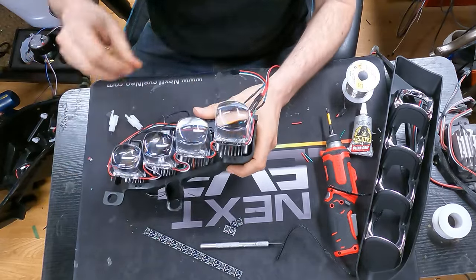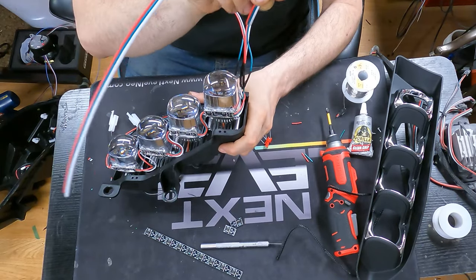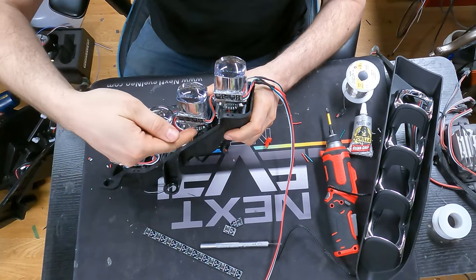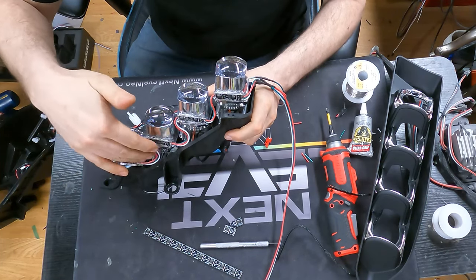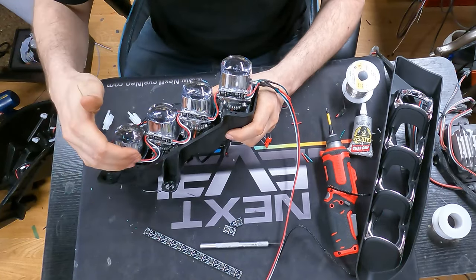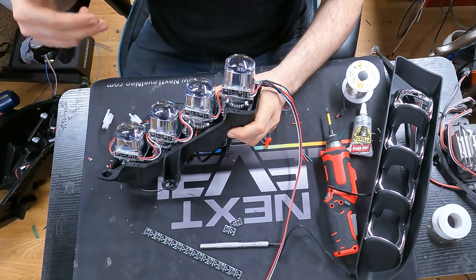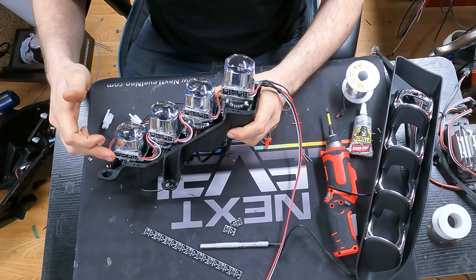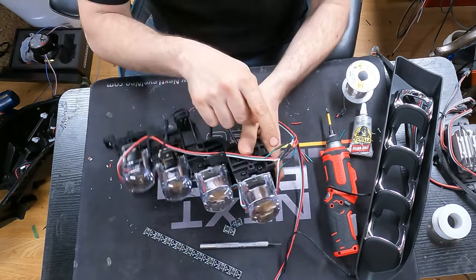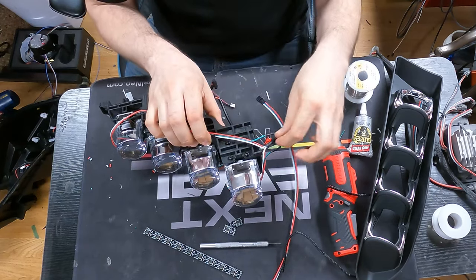The wiring is ran through here. So this is going to be my input wire. I ran it a little bit long because I'm going to run this out the back of the light, and that will be what connects to the controller. Then it comes in here, it goes up and just steps back, and I just tucked it back out of the way. That way the little bezel can go right on top and not have any issues. And each board feeds into the next board with a slight angle, so it's aimed forward, a little better output that way. At the end, it comes out here, both power and data, and it joins back up here where I have the powers joining together.